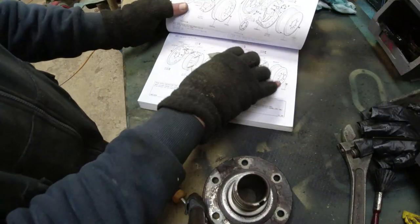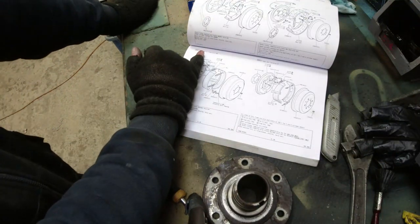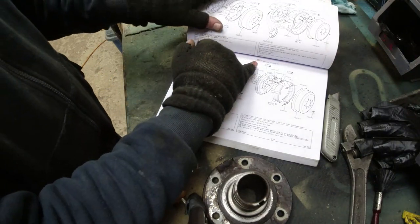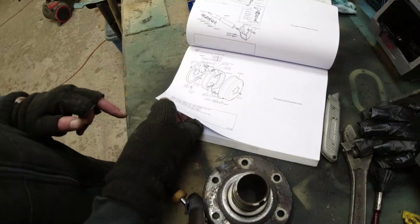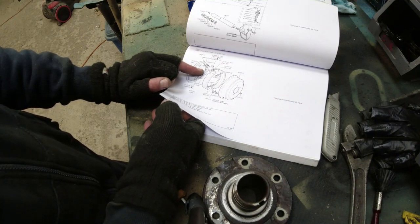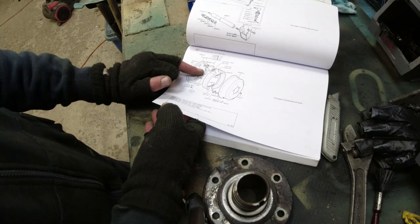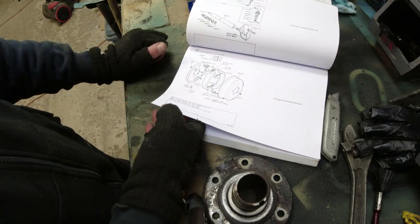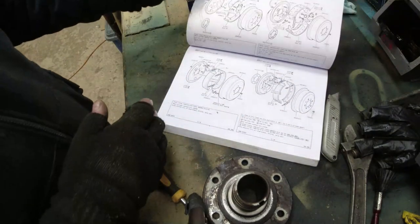So then we go to section 1L and we look at brakes. Here we've got the front 109, front 88 from July, the rear 109, front and rear 88 up until June 1980. So basically, the front and the rear had this single cylinder with a single leading shoe braking arrangement, okay? And you've got lots of left and right symbols going on here, arrows pointing to the right, arrows pointing to the left, etc. Not worried about up until June 1980, because this car's 1982.